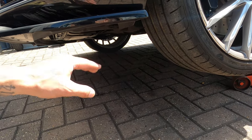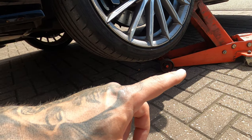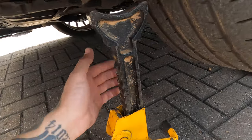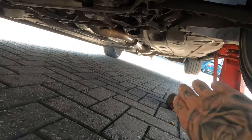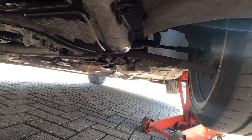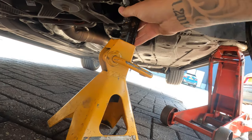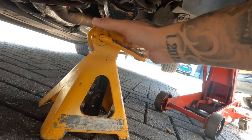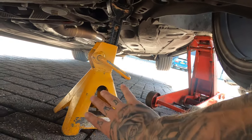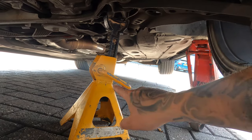This is how high the car is — I can fit under there. I'm first going to put a safety stand under here so if the jack slides away the car cannot fall. Make sure you put it under a firm piece of metal, like the subframe. Put one of those under there for your safety, just like this. Make sure it's standing correctly — now if the jack goes, the car won't fall down on me.